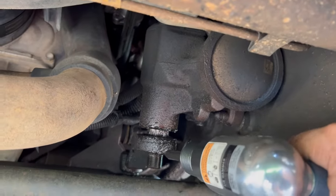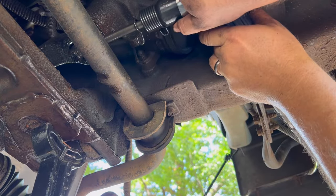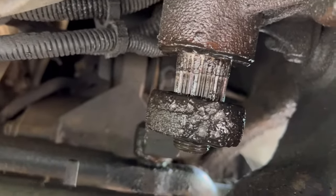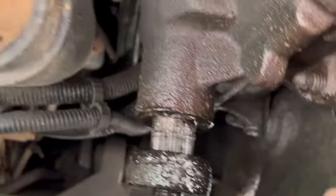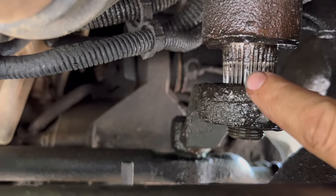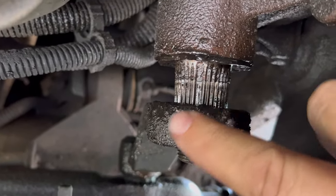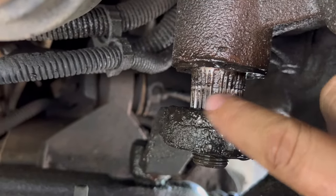We're going to try a little air chisel here so we can knock it loose. Since we're replacing this arm completely, it's not going to matter that we beat it up. Now, pay close attention to this — you see how there's a bunch of small splines and a big one? Make sure that when your Pittman arm goes back in, it is exactly big groove to big groove. I believe this is a three-groove. But before you take this down all the way, make sure your big groove inside here lines up with your big groove on the other side.